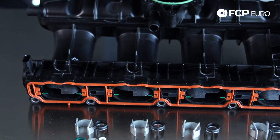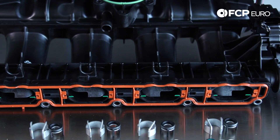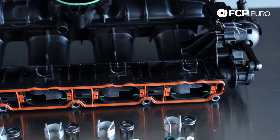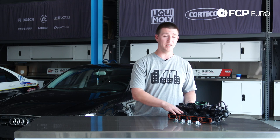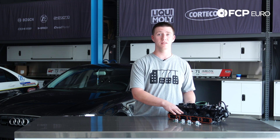Also please take note: the easiest way you can tell if you have this intake manifold is if you just take your engine cover up and you see this one-piece plastic. If you take your engine cover off and you see a two-piece aluminum, you have a flex fuel engine and this intake manifold does not apply to that engine.